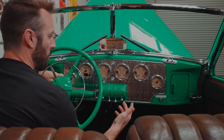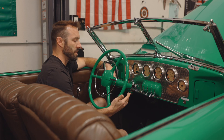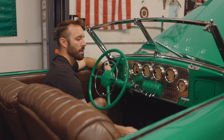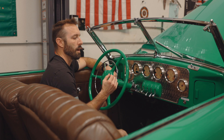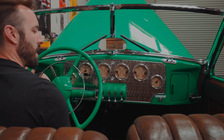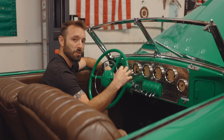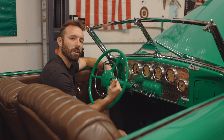Aside from the gauges, we had a couple of other things to incorporate — some of it's temporary and will be readdressed. We have our drive and reverse right here and then neutral all the way over here. When you start this thing up there is a Bluetooth app you can use, but when you don't want to get a ticket for a handheld device, you can press these buttons which have LED feedback: drive lights up green, reverse lights up red, and white is neutral. We work with a company called Billet Automotive in Australia to customize push buttons — one will be a hazard button, one will be regen enable/disable. We're also going to adapt the drive select into this OE shifter that used to change gears — you'd select a gear, push in the clutch, and it would shift for you. It's going to be really fun to integrate this into our T2C for selecting drive modes.